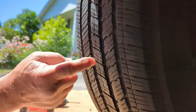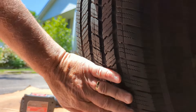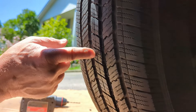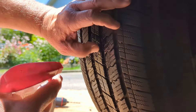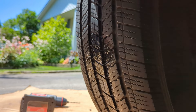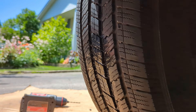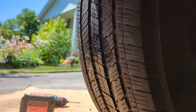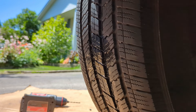There's only about a quarter of an inch of that plug left showing — all the rest is in there. Pull the tool out fast — that's it, that hole is plugged. Take a knife and shave that excess off. A lot of people put vulcanizing rubber cement on the plug when they shove it in, but I've never done that. I've done a lot of these plugs over the years and they last forever. That plug will last as long as this tire — the tire will wear out before that plug starts leaking.